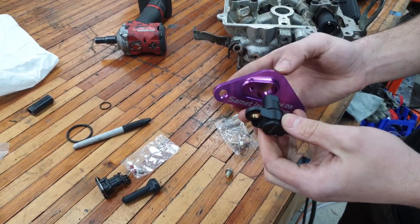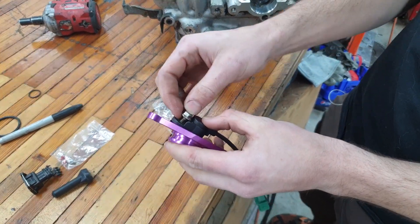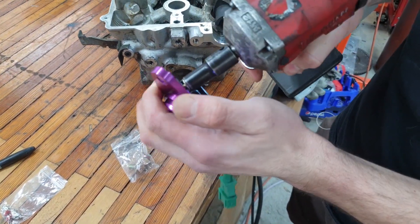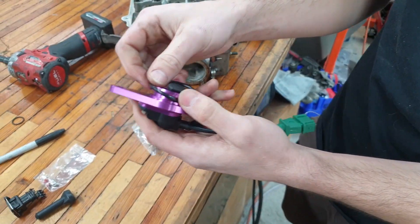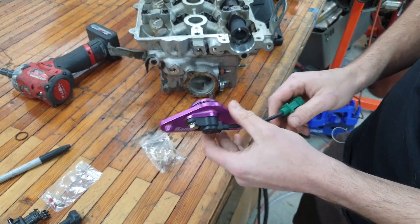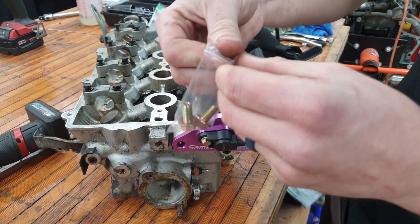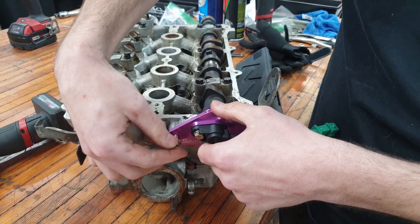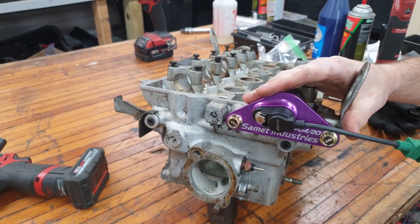This sensor will go in this hole right here - just squeeze it into place, then a single 10mm bolt right here to hold it in. We'll go ahead and put on our O-ring, which is the same as the distributor or CAS O-ring from the factory - we're including nice upgraded Viton ones for everybody. That will sit on the head just like that. Then you will have your two short M8 bolts that came in the kit to hold it in place. The stock bolts for your distributor are most likely too long since this is so much thinner - hence why we include new ones with the kit.